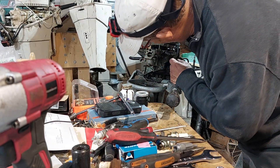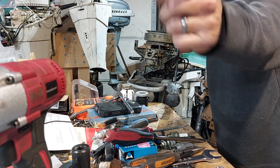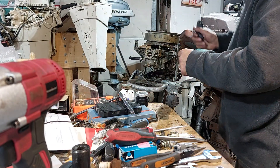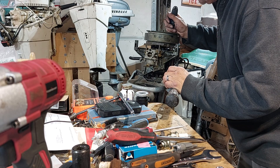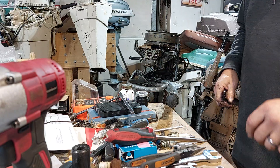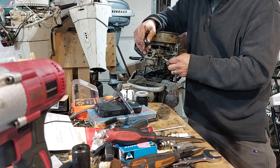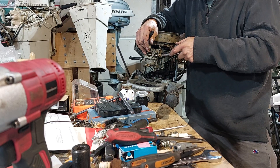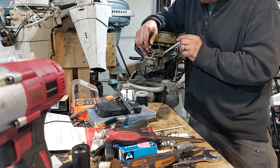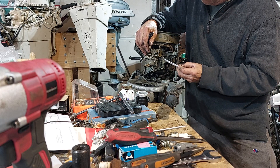Here's your little carburetor - that one's full of all kinds of white stuff. Probably the alcohol gas that we get now with the 10% ethanol - I don't think it's probably a lot more than that. Take a 7/16ths socket. There are two 7/16ths nuts on the carburetor holding that on. We'll get those off.